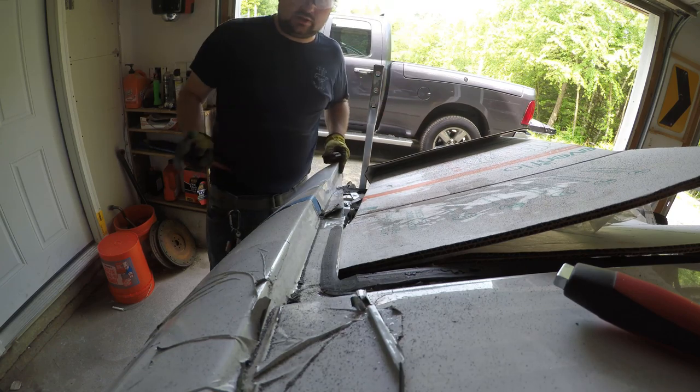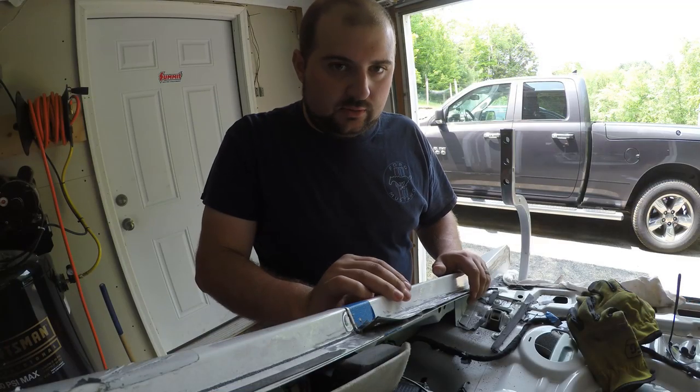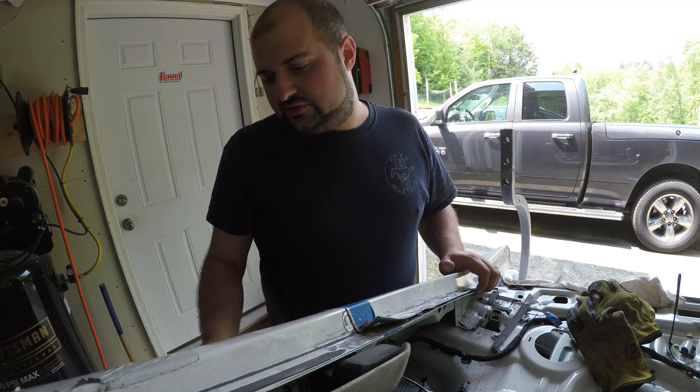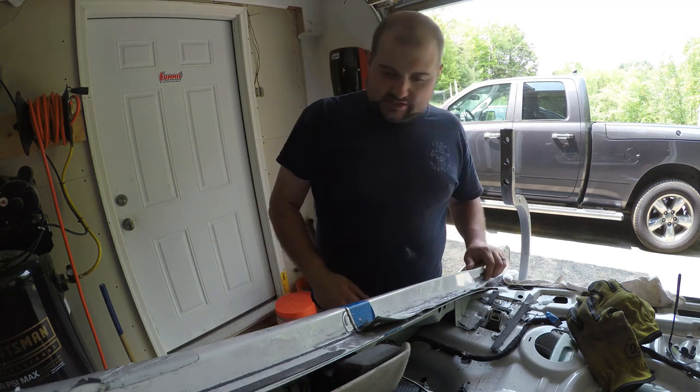It's actually come out pretty darn good. We'll do the rest of it. We've gotten all the spot welds ground out with our 3M belt sander up here on the pinch weld where the back windshield went. We've got two of the three sectioning lines cut, and now we're going to work